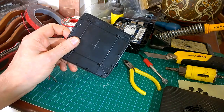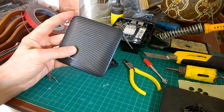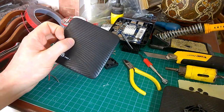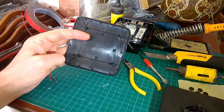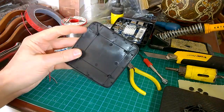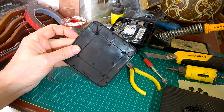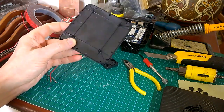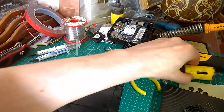That's pretty close. The other way of doing it, probably on this side, you draw a line from each corner to get the middle point, and cross it that way. It's probably not quite as accurate, but it should be good enough. I don't know how else I'd do it. You can measure it with a steel rule, or a ruler of any kind, and get the middle and mark it and do it that way. Find your center basically, and then drill your hole with a hole saw.